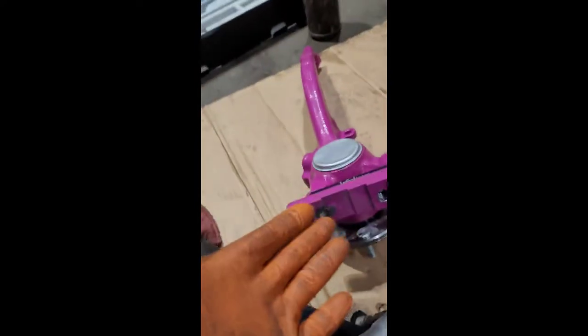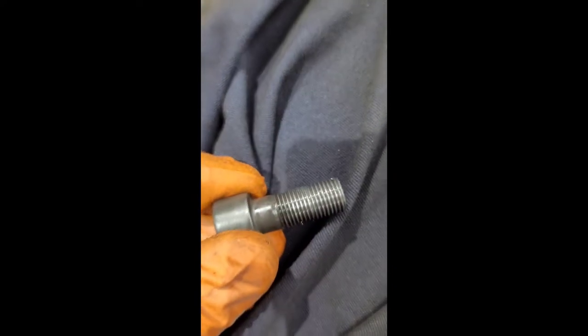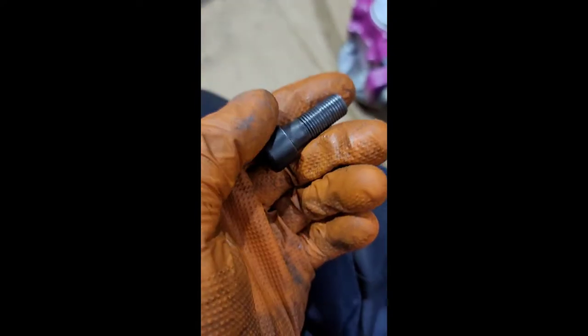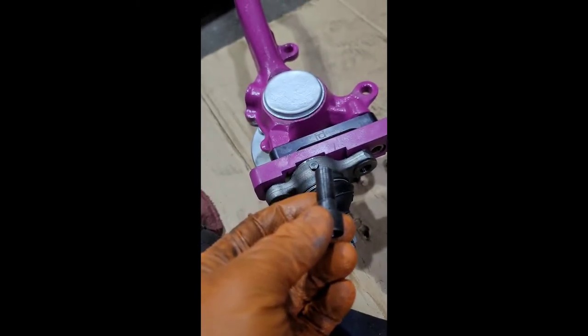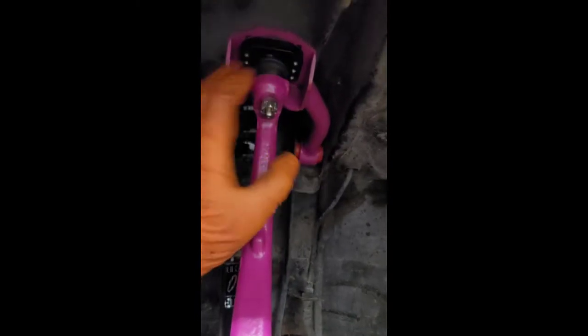The car is almost literally all put together except for this — this is the hardest part with no instructions. Now I can see the worn-down areas. I'll clean them up, spray with brake clean, let them dry, blow dry them, then Loctite and zip up the ball joint. Spindles are done. I can't believe it took me like three to four hours to do these — probably 1.5 hours or more, maybe four hours easy for just the spindles.